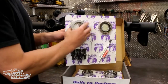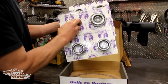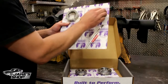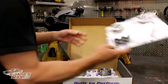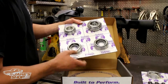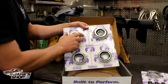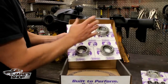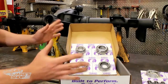Brand new in the kit — we have a bunch of things going on here, all from Yukon. I've got both pinion bearings, new carrier bearings, shim packs, a new pinion seal, and grade-8 bolts for attaching the ring to the carrier. Opening up the kit to get the races that are part of the pinion bearing. One thing that's really key in this process is you need to clean these races — even though they're brand new in the package, take them out and use brake cleaner with a glove. The other part you have to do is clean up inside where the old race was. I like to use a little bit of emery cloth — fine-grit — and get a glove, use some brake cleaner and really get that really clean inside.